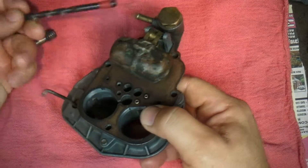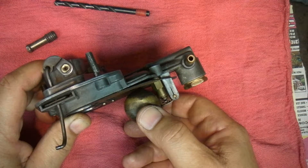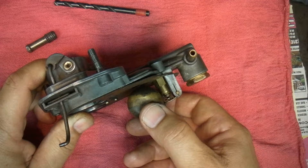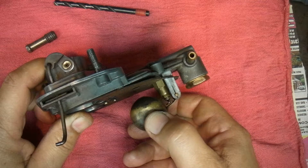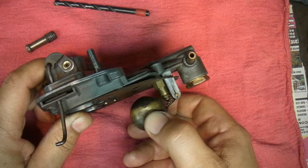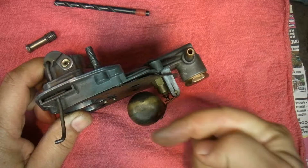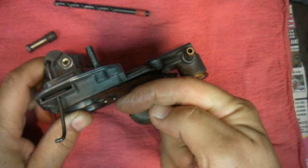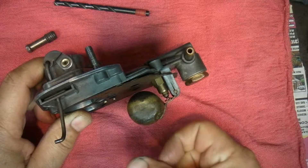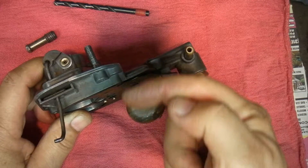What was happening to me is the idle circuit was not getting enough fuel. My float was down here when it probably should have been up here. What that did is raise the level of fuel inside the float bowl, and once I raised that level, the idle circuit was able to pull more fuel than it was with the fuel sitting lower.